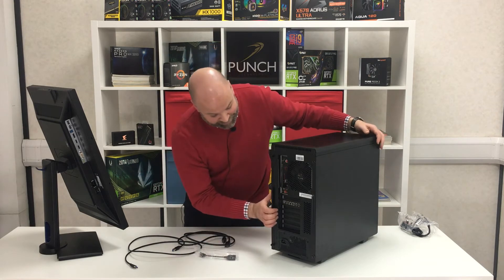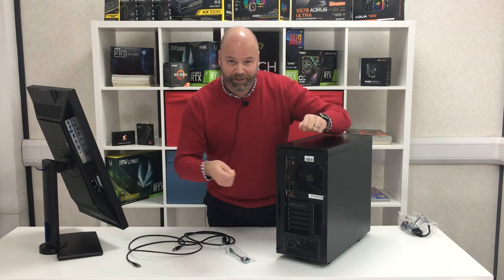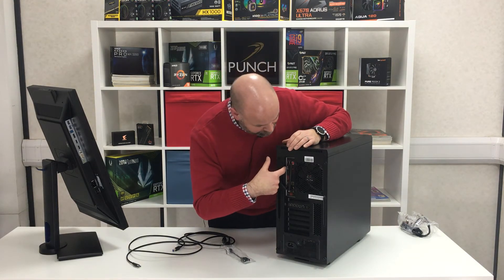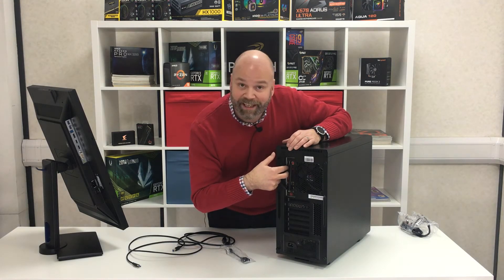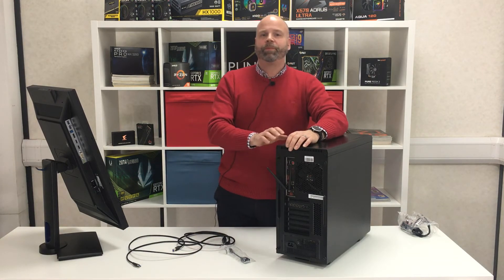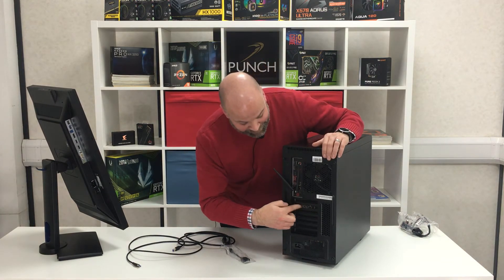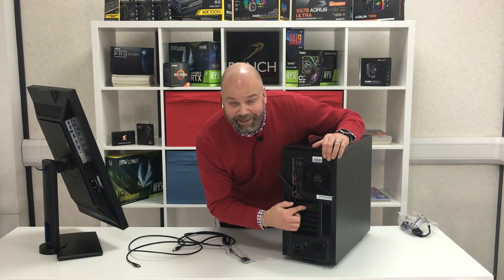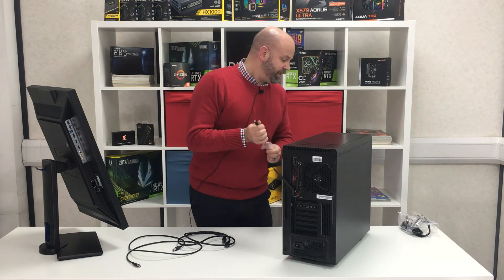In this particular PC, here's the other big misstep. People get all their cables out and the first thing they do is go to something they recognise — the motherboard backplate — and they start using the display outputs there. A good proportion of people take a PC from us with a graphics card in it, and the graphics cards are down in the expansion slots. On this particular Radeon graphics card, I've got four mini display outputs, and this is where you plug your monitor in. Very, very common mistake — it accounts for an awful lot of our support calls.